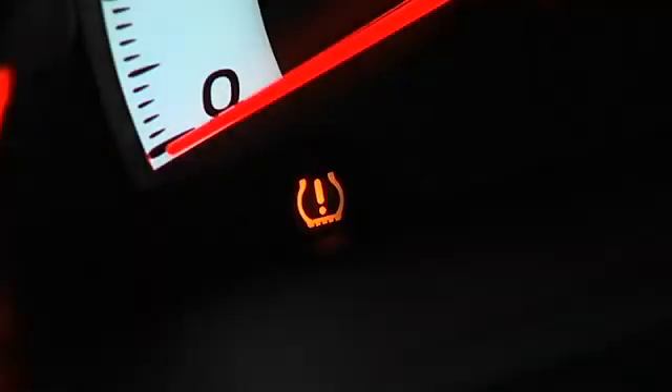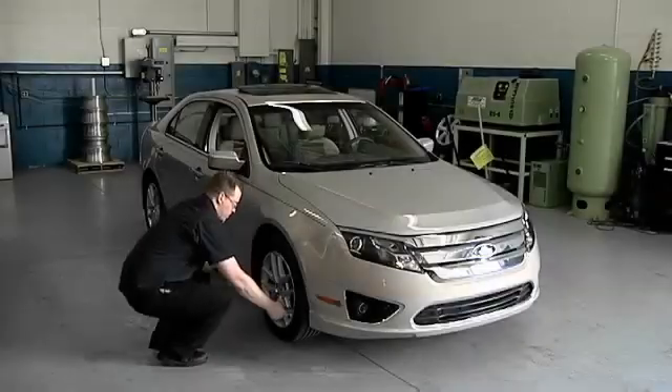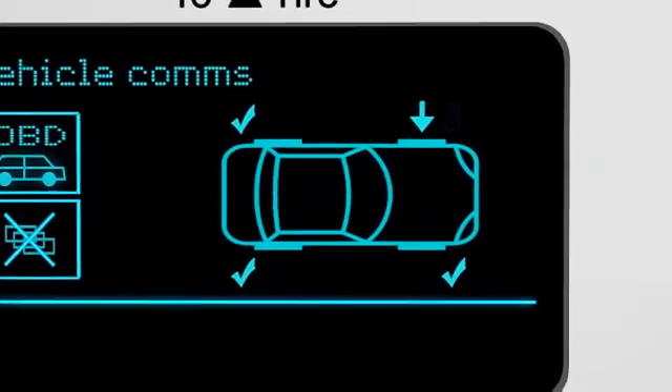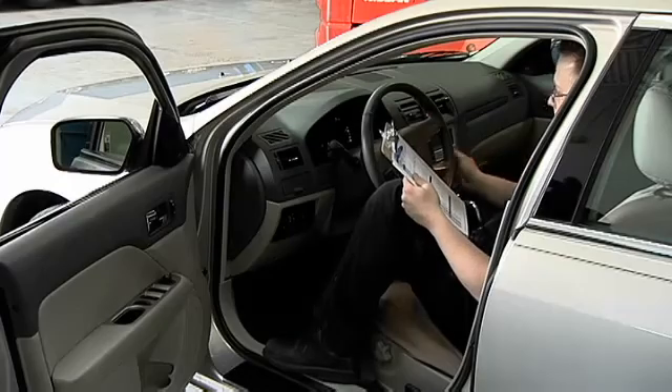First of all, let's follow the recommended test before you touch process. We enter the make, model, and year of the Ford Fusion and then proceed to test all the sensors on the car. The test result on screen shows that the TPMS on the front left has a faulty battery and therefore needs to be replaced. You can now get the go-ahead from the owner to replace the sensor before you have touched the car — test before touch.